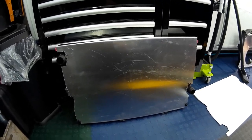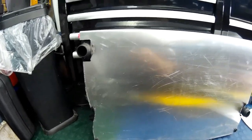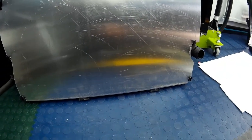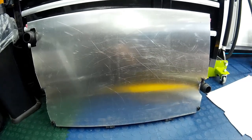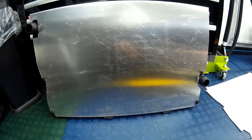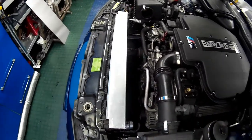Now we've done the initial cutting so the shroud will fit our template radiator. We'll clean up all the rough edges using a file and clean off dirt and debris using some 1200 grit paper. We can then offer this up to the car to make sure it all fits nicely before we start cutting the holes for the radiator fans themselves. Once you've done all your cutting and adjustments, this is what you should have.